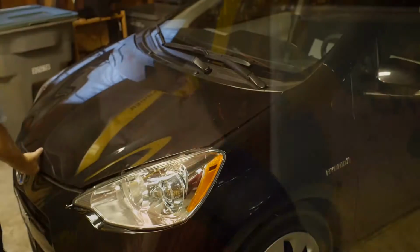Okay, it works. Now, this 400 watt element is going to burn out unless it's got something massive like the engine block to dump all its heat into, so don't leave it plugged in for very long. Okay, let's head out to the garage and do the install.